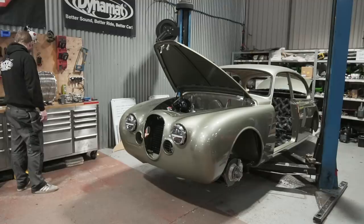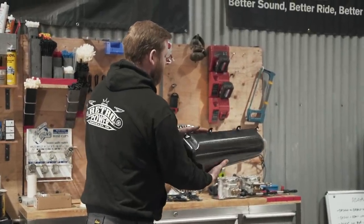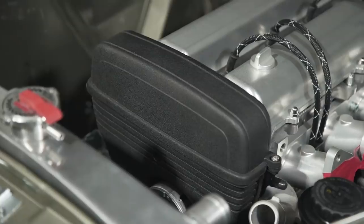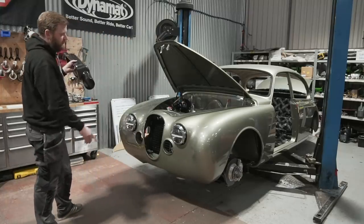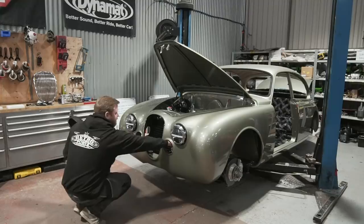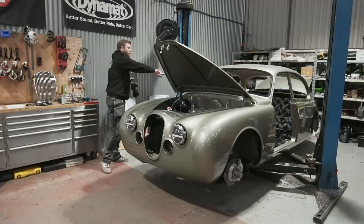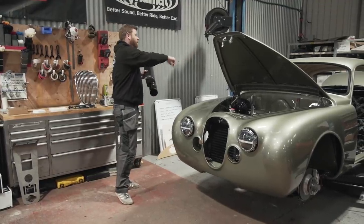Other things to note in the engine bay - the airbox. This is the carbon fibre airbox that goes over those throttle bodies, with a filter inside. We're going to paint this with a crackle or wrinkle black finish to match the cam belt cover and a couple of other engine bay details. It sits into an aperture in the inner wing made at the metalwork stage, and is ducted through a hole in the inner wing to an intake at the front. The other side feeds a pipe which runs all the way back to the kick panel area, with a duct for heater and air-con intake air rather than the original pop-up scuttle intake.